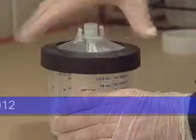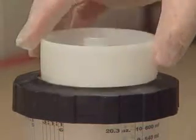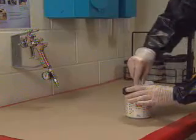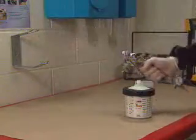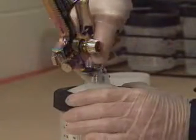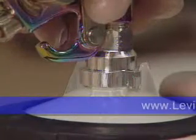If the paint needs to be shaken, the 3M PPS shaker core is used to protect the mixing cup while it's clamped in the shaker. The lid can be sealed with a cap, or if the paint is going to be used immediately, the mixing cup is fitted to your spray gun. With the mixing cup upright, the gun is inverted to fit over the lid and locked in place with a simple half turn, making sure that the lid fingers fully engage the adapter.